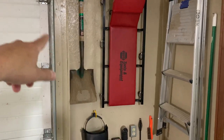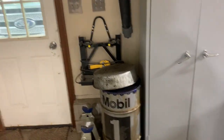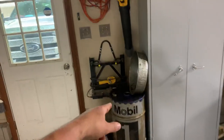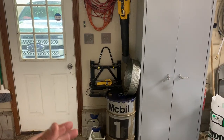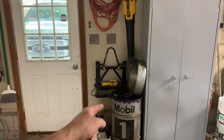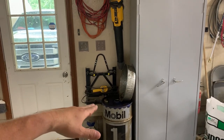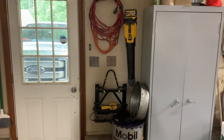I've also got a creeper, step stool, shovel for cleaning stuff up, and a waste oil can. You can pick these oil cans up at places like Jiffy Lube. What I do is drill a bunch of holes on the top so when I get waste oil from oil changes I just let it drip in. You can use that waste oil for lots of things — one in particular is treating wood posts. You do a 50/50 mix of diesel fuel and used motor oil, soak the bottom three or four feet of the post for a couple of days, and then put it in the ground. It's basically like a treated post.